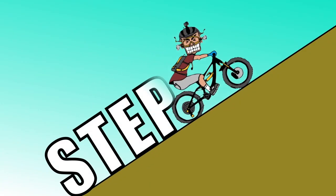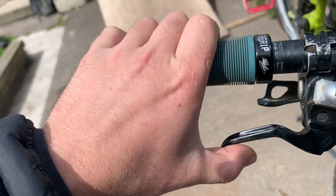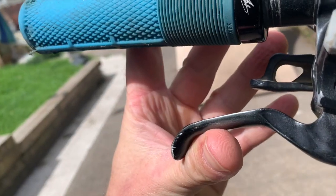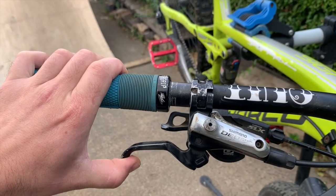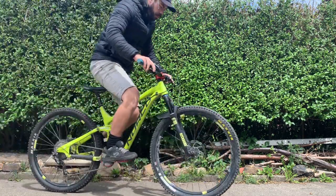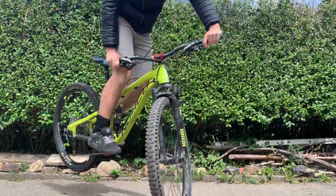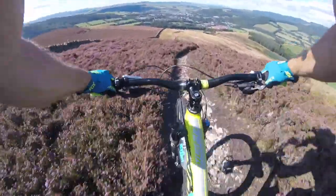Go nuts on the nipple. Maintaining a generous level of fluid in the funnel, open and close the bleed nipple while pressing on the lever in half-second intervals or so to quickly flush out any last bits of air. And once the brake lever has a solid feel to it and a short travel distance when it pinches, you've cracked it. So once you're happy with that, you should leave just enough time to test it out. The way I've shown you is what they call a full brake bleed, which will always give you the best result if you've got the time to do it.